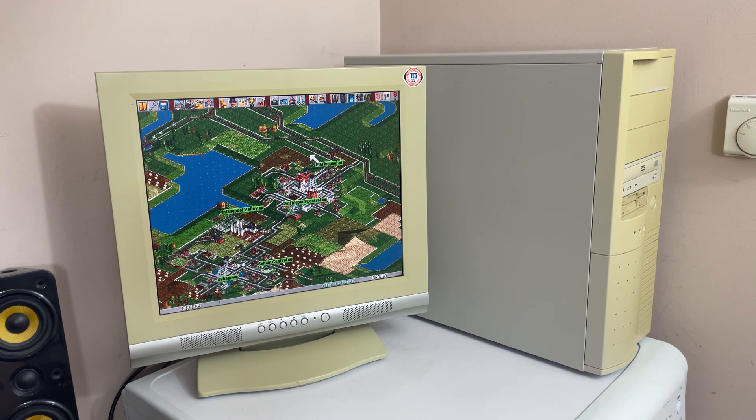The motherboard in question is a GMB-P57SAX-V1, however this is actually a rebranded DTK-PAM0070SE1. It is capable of running almost all Socket 7 CPUs that use a 66MHz bus. For this build we will be going with a 166MHz Pentium MMX. On the motherboard it also has an integrated SIS5598 for VGA which shares up to 8MB of the system RAM, and the popular ES1869F sound chip.